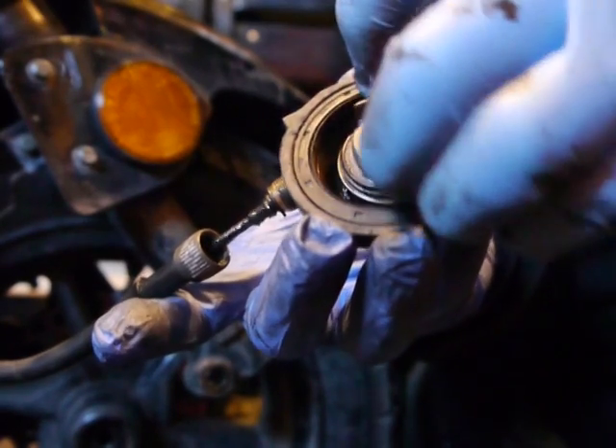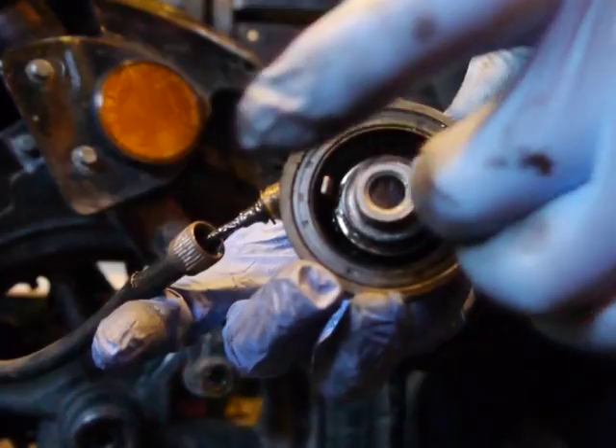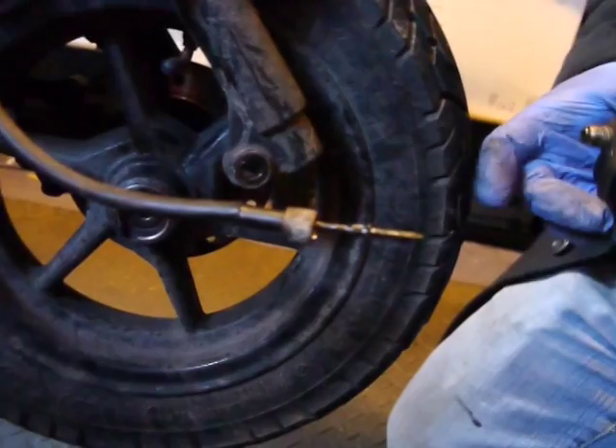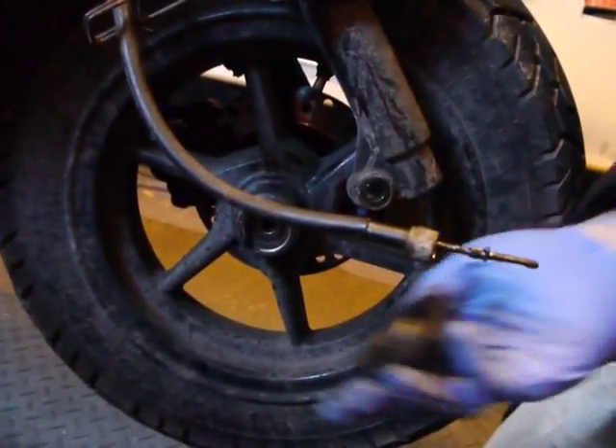Watch the cable now when I turn here — can you see the cable turning? Yes you can. And there you go — this is that easy a fix. It's not hard to get this off the wheel: 14mm, drop half a wheel, it comes out in your hand. You don't need to take the whole wheel off.